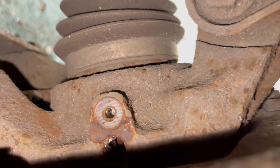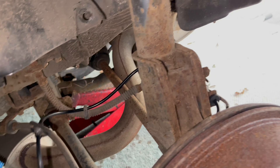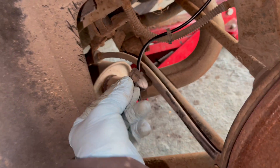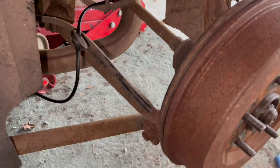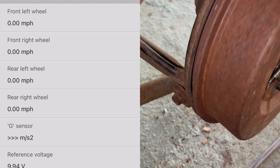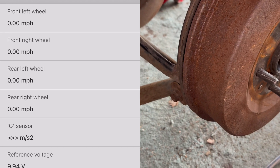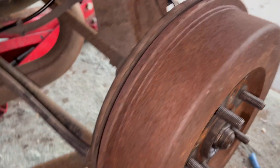Superficially there doesn't seem too much wrong with it from the outside. It's a little bit hard to see down that hole even with the camera, but I can certainly see something rotating as I move the wheel. So in the first instance we'll just try a new sensor. We've got a new sensor fitted - put a bit of copper grease on the unit to make it slide in easier. The cable is a little bit longer and has a slightly different fitting, even though it's meant to be the right part number. I'll just cut the rubber off the old one and put it in place. But I like to test it first on the live data on our AP200C dongle - rotate the wheel, and there we can see in the live data it's now reading about the same miles per hour on the rear left and right. It's now working, all good.